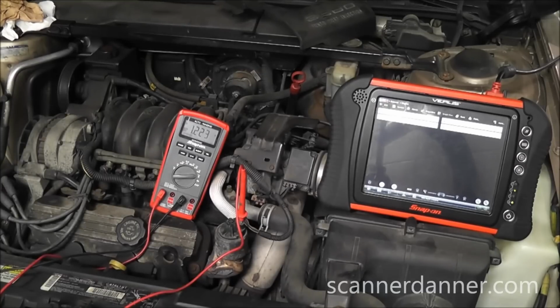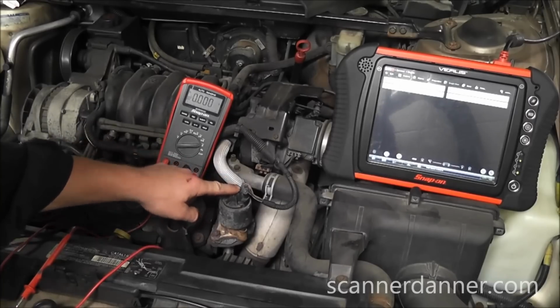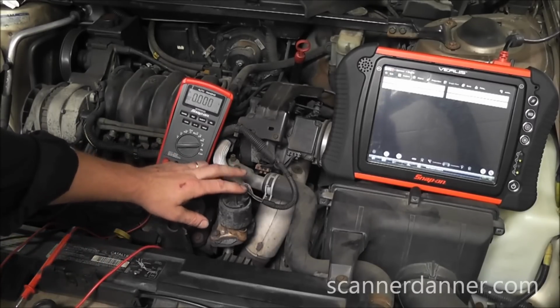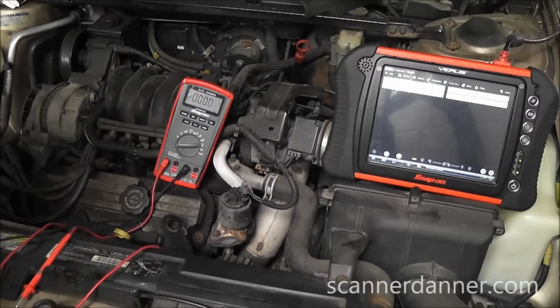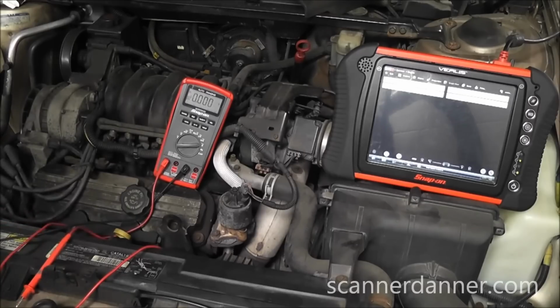All right, so quick recap of what we've done here. We did a nice review on a GM 5-pin linear EGR, a very commonly used valve. Chrysler, Honda, GM, they all use a version of it. Testing is very similar, although be careful with your polarity. Some of the newer ones will power side switch them instead of ground side switched. Don't just get in there and start jumping things to ground unless you absolutely know what you're doing. I showed you a way to identify that with a voltmeter. For more info on that, that's section 3, refer to it. Don't do this kind of procedure unless you absolutely know the polarity of that solenoid.